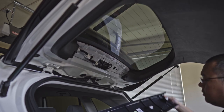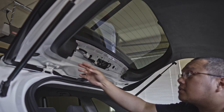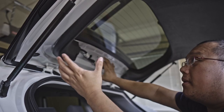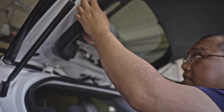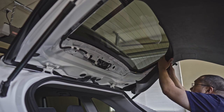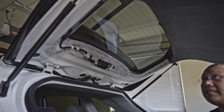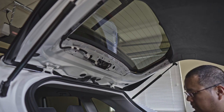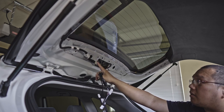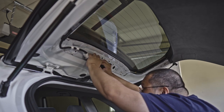There you go — nothing breaks, just pull them. Next will be this side. Once you pull this middle part, it's very easy to remove. The long cable we will connect to the third brake light over here, so we're gonna unplug this connector here.